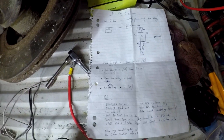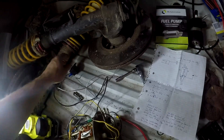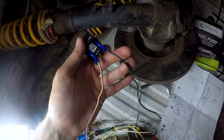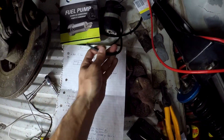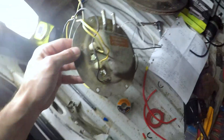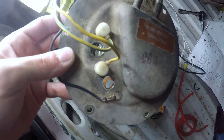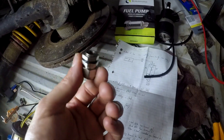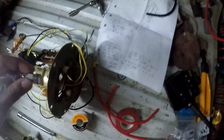This wire is overkill but it's just what I had - you can use much smaller wire than that. Then you've got your wire from the relay to the pump. I've crimped on the ends - that's the purple and white one. And the black one with two layers of insulation. I've drilled out these two holes which originally had white caps, and instead I'm using IP68 grommets. They're really good for keeping out water - we use them on switchboards at work - so they'll keep fuel from coming through the holes.